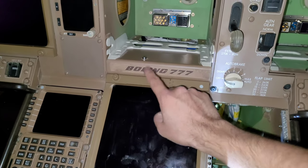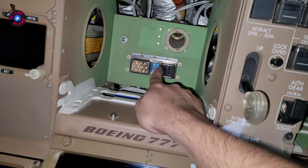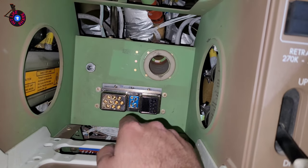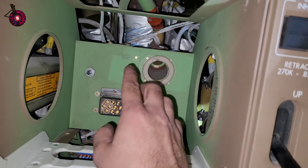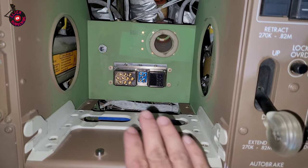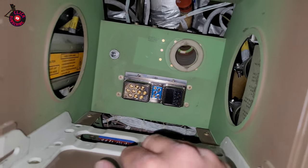Let me give you a little description. This is our plug — never touch the pins because of ESDS precaution. This is for cooling. Before we install, we'll verify the area is clean, there is no FOD, and the pins are okay — not pushed back or bent.